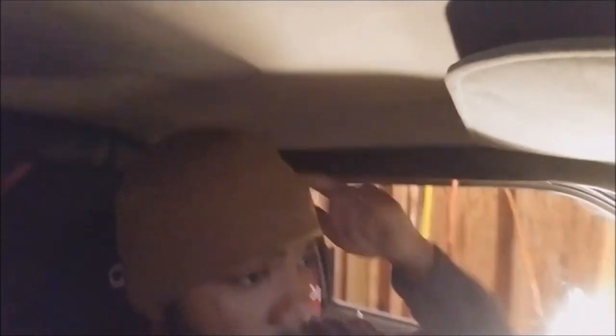As you can see behind my head, I can lean my head back in a natural position — it's not pushing my head forward. It's also still comfortable when wearing a helmet. The other drawback is the seat is a little bit tall — I have about two fingers of headroom right now, and when I have a helmet on I barely have enough room to fit a finger through, and that's using aftermarket seat rails. What I'm actually going to do is make my own seat rail to hopefully drop it at least an inch, maybe two inches — the upright positioning is pushing my head closer to the ceiling.